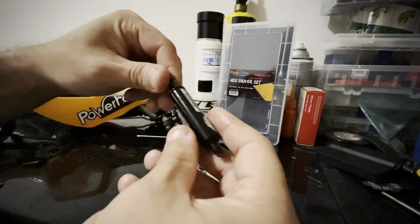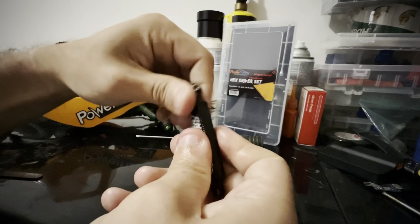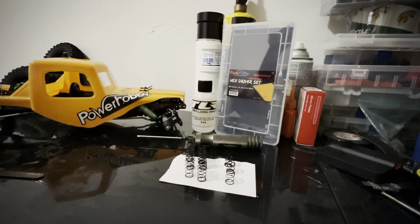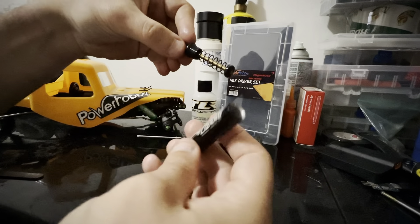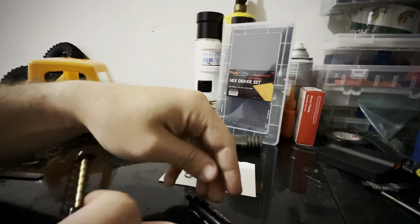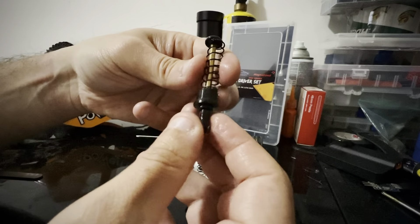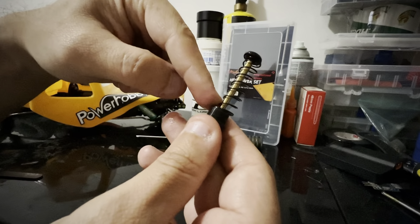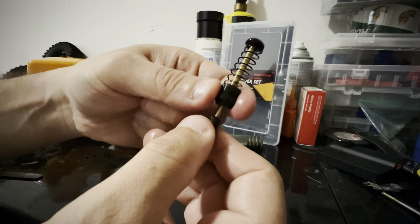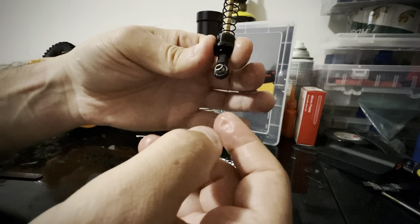So, to use the shock: when you get them, you loosen up the top and clean out the oil. This here is the barrel — pretty simple. And this is the shock shaft, the cartridge. As you can see, I'm using the longest, softest spring below the piston. When you pull the shock shaft, it's going to suck it back up — that's full droop.